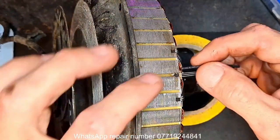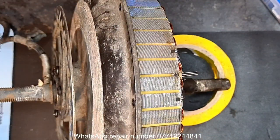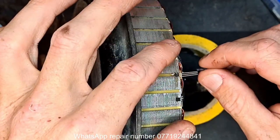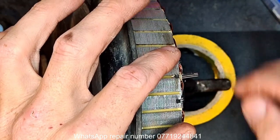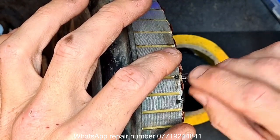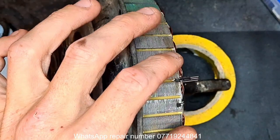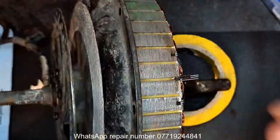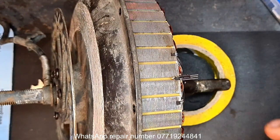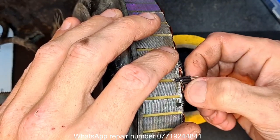So let's cut these to the right length. I'm going to go that, I think. One, two, and three. Let's just make sure the actual pins of the sensor don't make contact with each other over time, I suppose. You can lay it down if you've got a steady hand. Make sure they're not making contact, slap them together, put some conformal coating on, some epoxy, if you was at a push, I suppose.